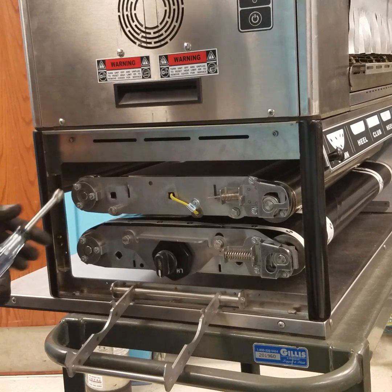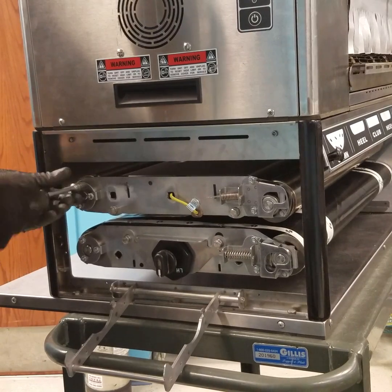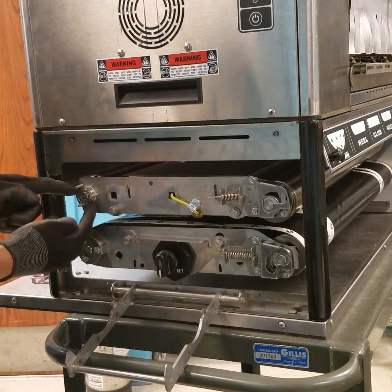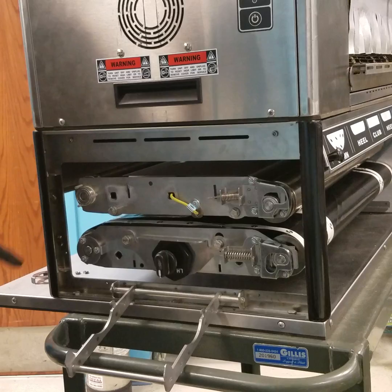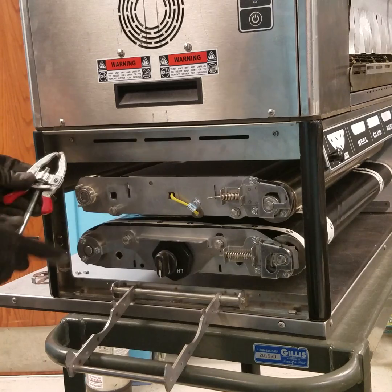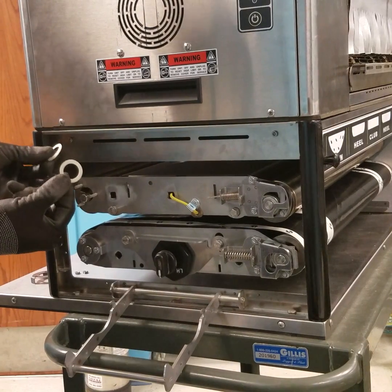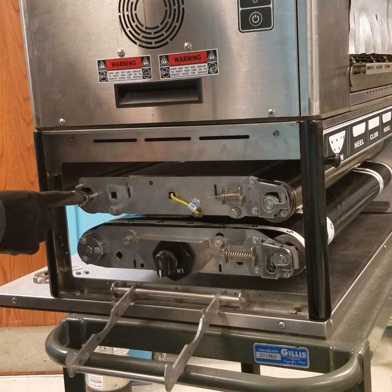Use an 11/32 nut driver and remove the 3 hex nuts. Remove the retainer and remove the ball bearing from the shaft. It's a pressed on design. In some cases, if it's stubborn, you can incorporate the use of a 2-jaw puller to extract the ball bearing from the shaft. Remove the old ball bearing and the 2 nylon washers. The kit does include an extra ball bearing to replace at this end.